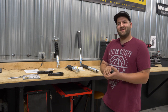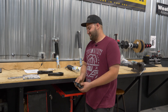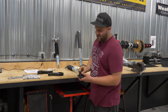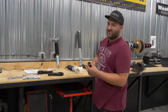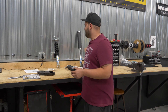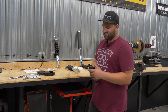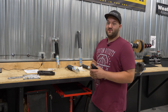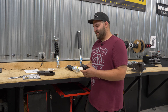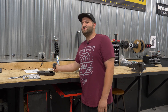One thing I probably should have mentioned is these leveling kits will come with these spacers here. What they're actually for is the top of the strut spacer. They provide these in all their leveling kits, even though they're only needed if you're buying the leveling kit without shocks and you're gonna reuse your factory shocks. These spacers basically space out your factory shocks so they don't overextend. They give them to you in the kits with replacement shocks even though they are not necessary, so you get to start collecting these because they won't actually be used.